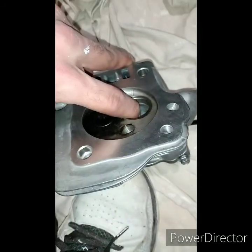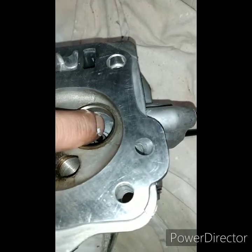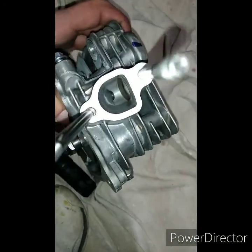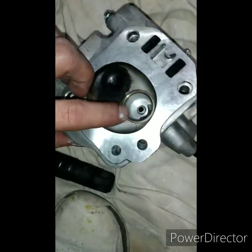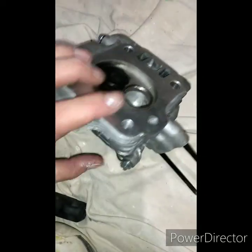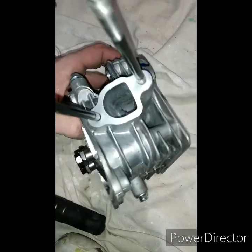I'm going to try to do that one there. You just want to round everything off — mild port. You don't want to really mess up the airflow too much. I'm trying to come in through here so I don't hit the valve seats. You do not want to hit these valve seats. It's a good idea just to lap your valves after doing this anyway, just to be safe. It won't hurt anything.